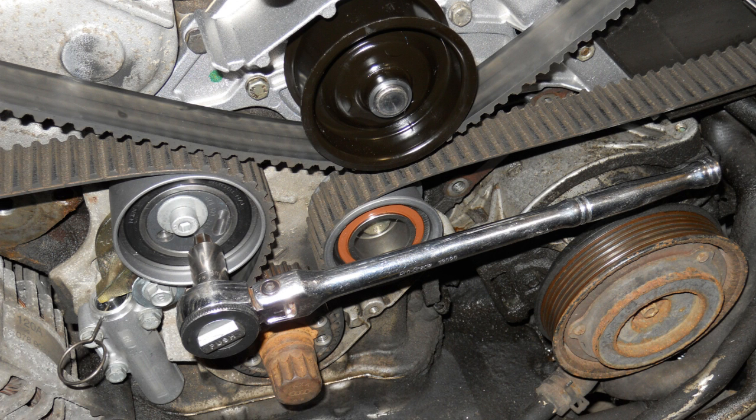Using an 8mm Allen wrench, very slowly and evenly turn the hydraulic damper idler pulley clockwise to compress the hydraulic damper. This will loosen tension of the old timing belt. Align and insert pin tool T40011 into the hole near the top of the hydraulic damper to keep the damper retracted and the belt loose. Failure to compress the hydraulic tensioner damper in a very slow manner can result in the incorrect transfer of fluid within the hydraulic tensioner damper, causing it to lose its ability to tension the timing belt.